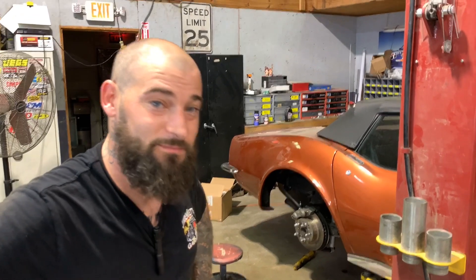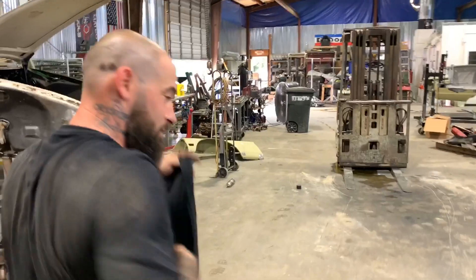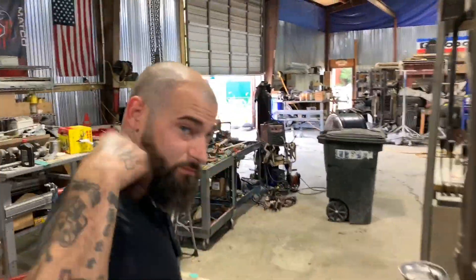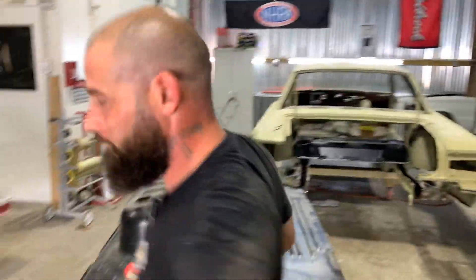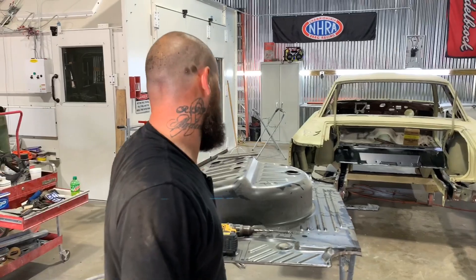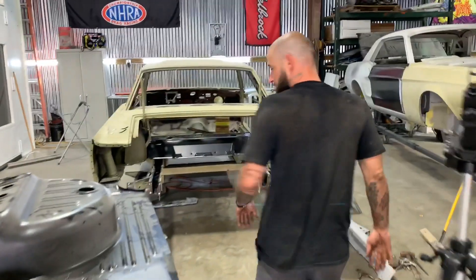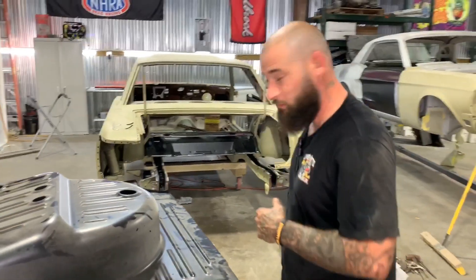Matt's been helping Bobby a little bit with the Coronet this morning while working on the Corvette and the Road Runner. Bobby got the trunk pan in, got it all test fitted, and went back and made some lines. He had to take care of some personal business and should be back later today. We've got Austin in here drilling holes for the spot welds, drilling about every two and a half to three inches. Then we'll go back and grind a bit to knock the paint off so we can get a good weld — you've got to clean your metal before you can get a good weld and good penetration.